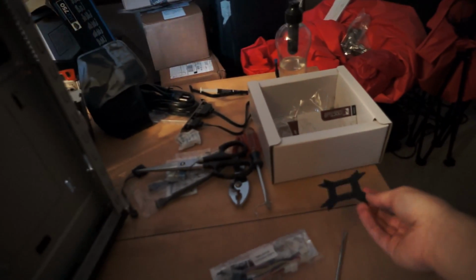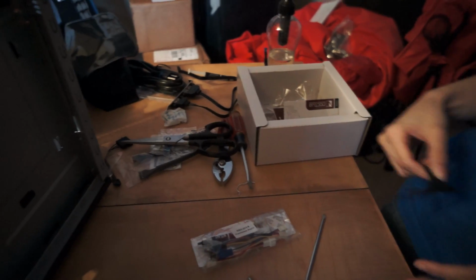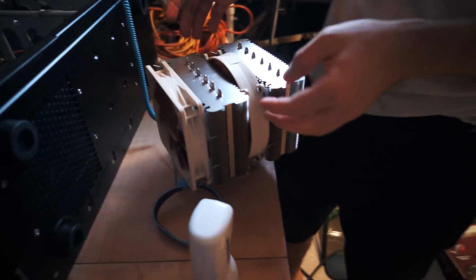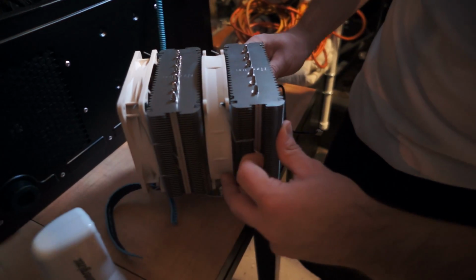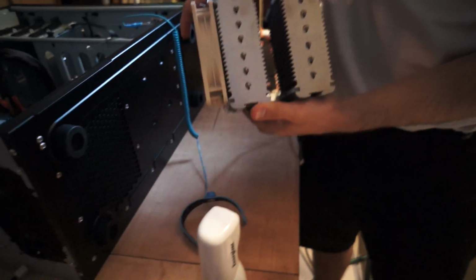Alright, so now it's off. By the way, this thing was connected to it, and we had to take it off in order for it to sit on there correctly. I didn't show you that. It's for a certain motherboard, for 775, I think. Take that off for 1155 and 1156. For this fan, in order to screw this down into the motherboard, I have to take this fan off in order for the screwdriver to reach. You just grab it with your fingers like this, you pull, and then you go out. That's how it snaps on there. Now I can reach those screws, as you can see.